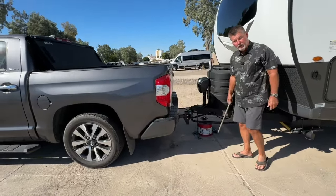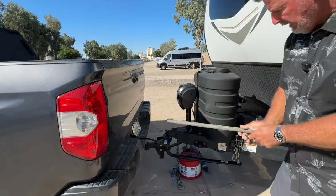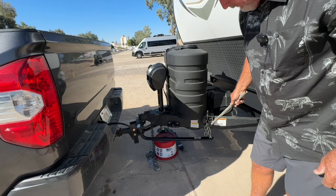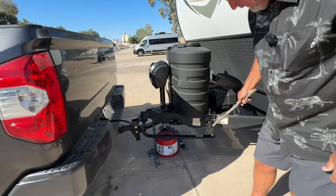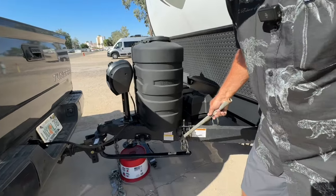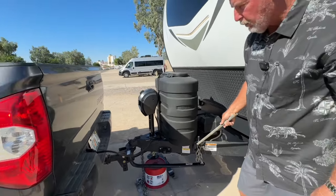And what people fail to do is jack their vehicle up really high so they can get just those last 3 links, 1, 2, 3, and it's on the fourth link. So you have 1, 2, 3, 4, 5. It's on the 5th link. That's generally the number most of them will take.